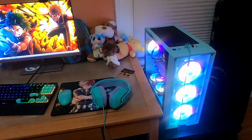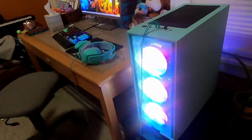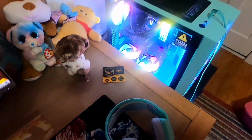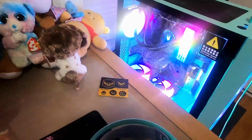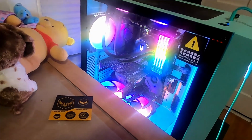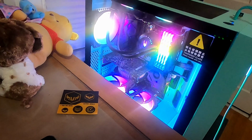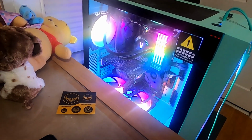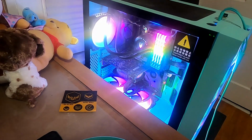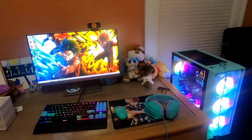Alright, so this is the final build with all the glass and the back panels put on. It's all completed. No longer need that aftermarket USB Wi-Fi antenna because it's got the built-in antennas in the back. Everything good to go there. That 2.5-inch SSD on the back, I cloned that to the NVMe drive on the front, and then I wiped out the back and reformatted it, so now there's just an extra terabyte of storage, and the boot drive is right on the front. I never had to reinstall Windows or anything like that. So that is it. Thanks for watching.